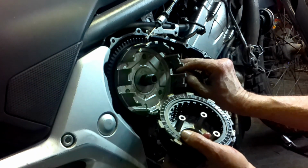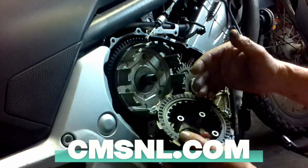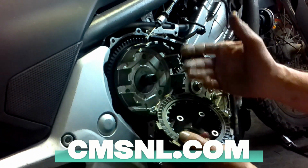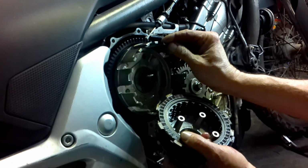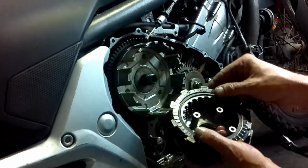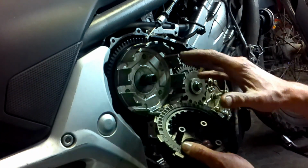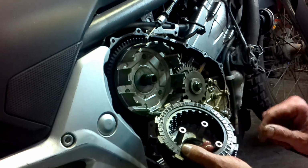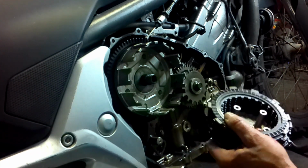On the cmsnl.com website they have a very nice diagram, and I'll put a picture up in the video that you can see. If ever you strip an engine, make sure to visit CMSNL. This video is not sponsored by them, but it makes life very easy. And remember, you have a little washer at the back that needs to go in as well. So when you're doing this clutch job, take your time, do it properly, clutch out, clutch in, assemble it, and it's sorted. So let's go measure with a vernier what the difference is between the two clutch packs that we have currently, and take it from there.